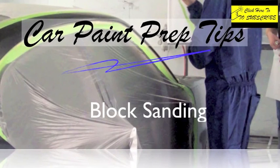Okay, let's get back on. We got the primer surfacer sprayed. Now we need to block sand it. And I generally use 320 grit, block it out. And you want to use a block because we're trying to level the surface, make sure that all imperfections are smoothed up and all scratches are removed.